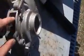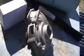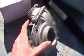It also says, according to all data, to replace or switch over this outer plate right here. But if it doesn't have this hole, it just won't be able to leak water. Also, what it will more than likely do is make a loud whining noise, which this one here does. It's not really that bad, but as you rev up the engine, you'll hear a little whining coming from the water pump, and that's because it doesn't have this hole. But anyway, it's best to go with quality OEM parts, or an alternate OEM part, but something that is OE is what is recommended.